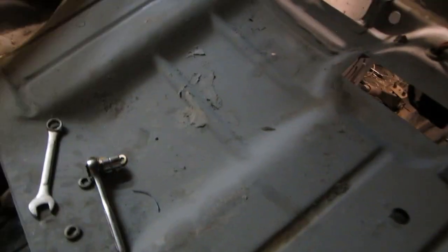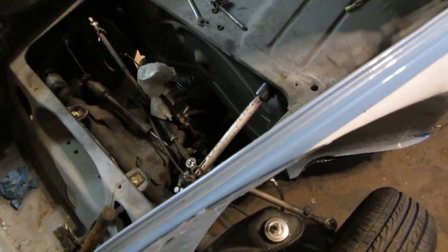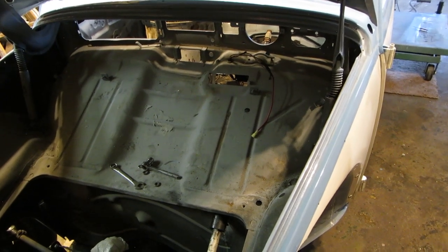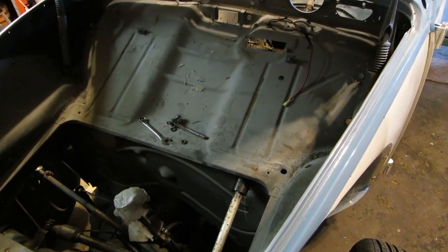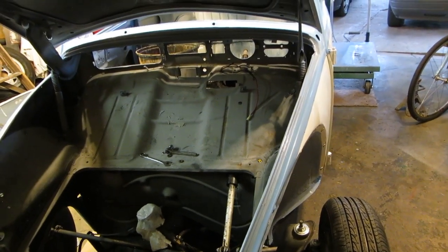About this urethane thing, I use urethane a lot, and you can get it free, and I'll tell you how. Go to a glass shop and go to their dumpster, and in their dumpster there'll be tube after tube of gunned urethane. If you buy a case of it, it's about $6 a tube for the glass guy, so they charge $10 or $12 a tube, you gotta make money. But if you go into O'Reilly's to buy a tube of this stuff, it's $22 a tube. The reason it's so expensive is it only lasts 9 months, and then it's hard.